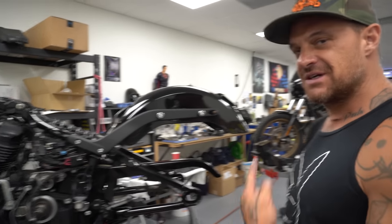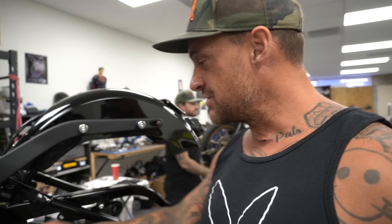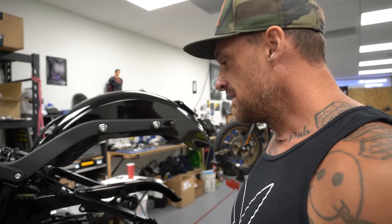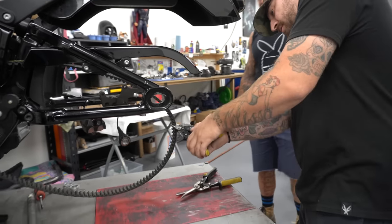Get the shears. This, we're cutting this off. I'm not doing all that right now. You gotta pull the pivot shaft, plus you used to have to pull the swing arm. Now they have a spacer so you can loop it through the swing arm, which saves you that. That, we're cutting it off with shears. Try number two.